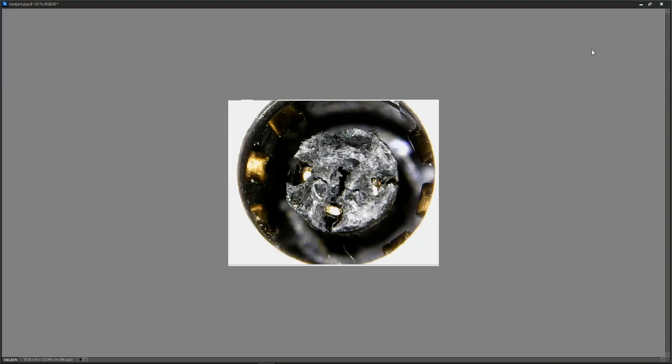Just one final note: here's a picture of another power jack from a similar Dell. You can see the ground pins and positive pins, but this is an absolute mess — I'm not sure if a crooked insertion causes the ID pin to dig into the housing like this. The important thing is: if you see a jack that looks this damaged, check the charger's ID pin as well, because it more than likely has a bent ID pin too. That's the video for today — please like and subscribe, post any comments below, and I'll be back with another one soon.